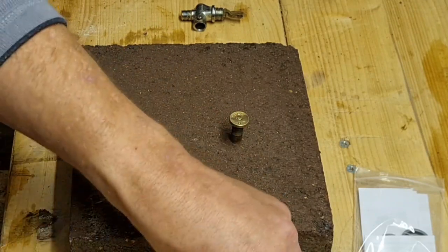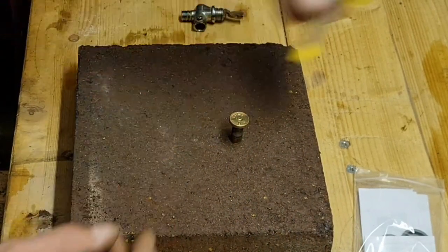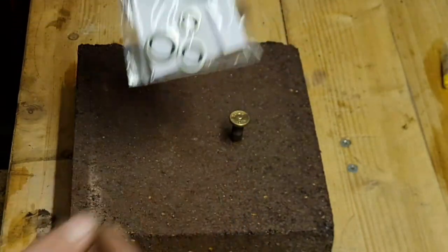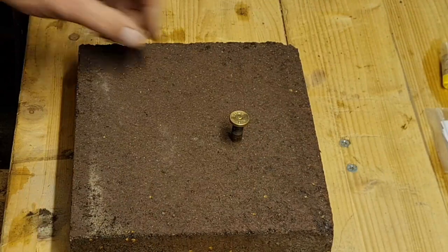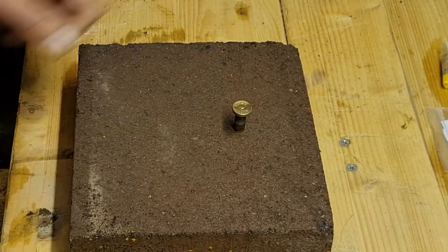They're all falling out! They give you five in the packet - plenty of room for error. And on this little kit you even get a selection of new washers to go on your petrol tap where it goes into your tank, which is really really good. So let me find a socket that this will fit in and then we can hopefully tap that through.